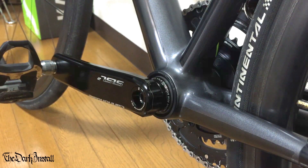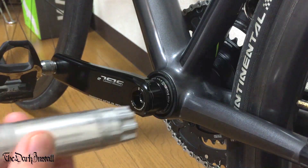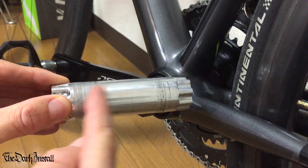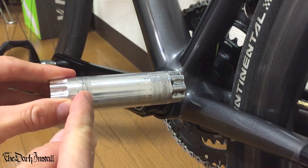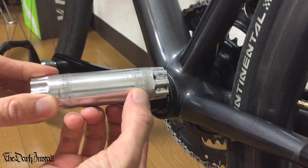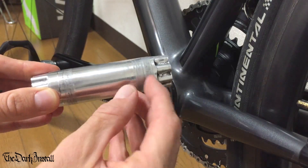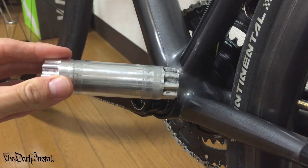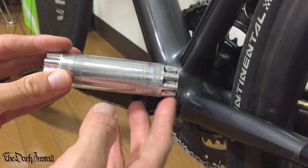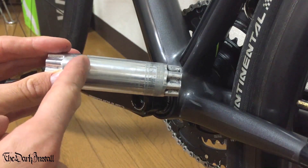Finding out how many washers you need is just trial and error. I originally set this up with one too few washers. Even though it felt completely compressed and okay when I installed it, in use over time it meant that there was a little tiny bit of play in the system, which buggered up the axle. If you look at this axle here, this is where the bearings sit — that's the non-drive side bearing side, this is the drive side. There was a tiny bit of play — we're talking micro millimetres — but that caused this to start creaking, and then it wore down a bit, which meant I had to get a new axle. Luckily these axles are actually quite cheap and Cannondale sell them almost as a replacement commodity item, which suggests they've designed this as the softest part.